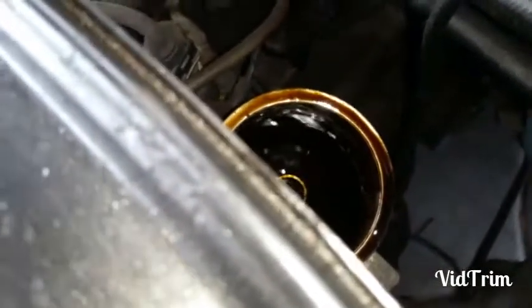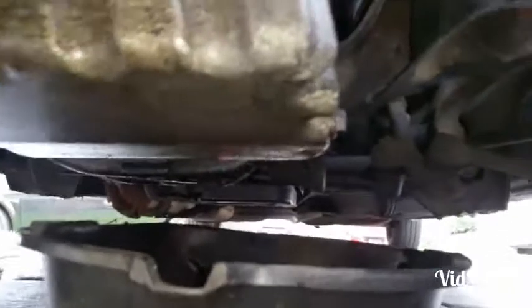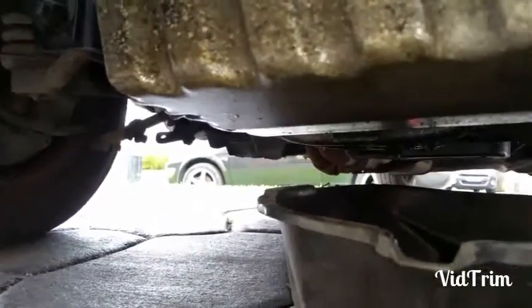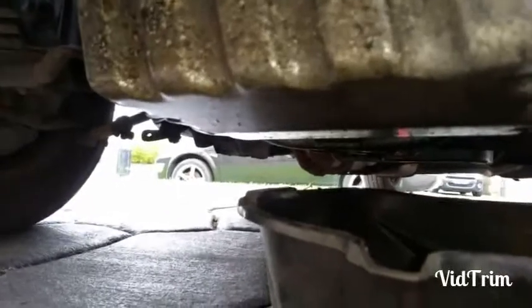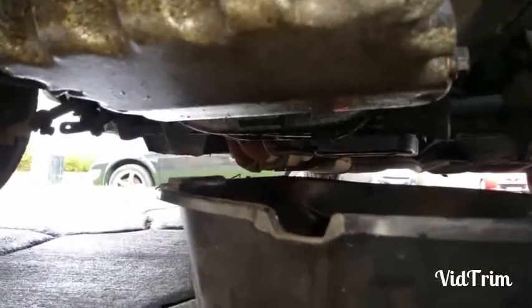Okay, so next up is, let's open the sump nut and get the sump drained. So, on with the rubber gloves. Got your cloth, got your ratchet, and got my basin up underneath. And there's the sump that we're going to open. Don't do what I done, in my wisdom that time I slacked off the nut on the top of the oil filter and then decided to move the car back, and moved it back about 4 feet up the garden.